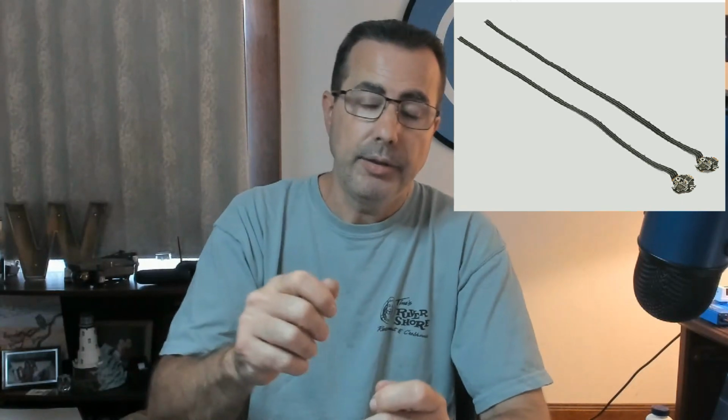You have 4 black wires. So what I recommend is you take and unsolder those 4 wires off of your brand new ESC and just use the ESC with your original wires. Because if you have to go and reroute every one of those wires back up through the arm of the Zino and into the body, it is a ton of work.